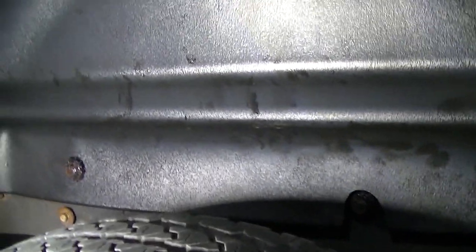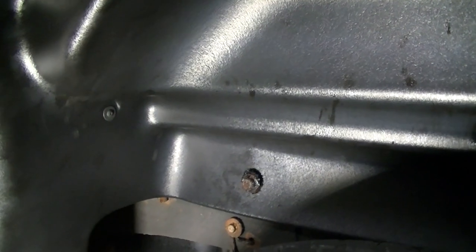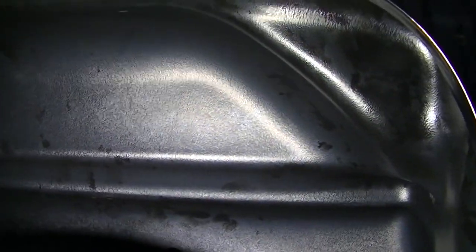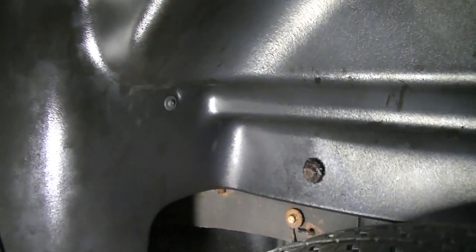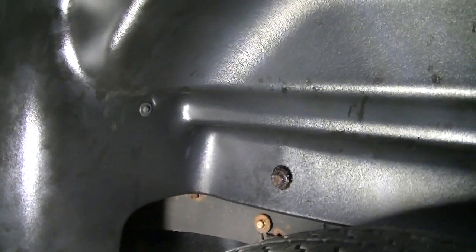Another reason I want these liners is because I'm fluid filming the whole bed, so I was going to fluid film this whole fender well. Fluid film is kind of a greasy substance so it's going to get dirty, and if I didn't put this liner on here you'd see a dirty inner wheel well all the time. Now with this liner I've put a heavy coat of fluid film under the whole wheel well. It shouldn't wash off with the pressure washer and it should keep the inner fender well from rusting.